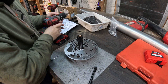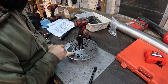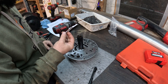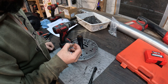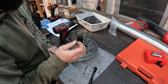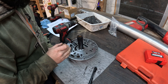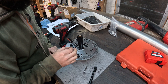This is the pump, and reading the instructions, this is your converter feed orifice. It says to drill it out to a 0.257-inch hole, three-eighths of an inch deep, so you can tap it out to a 5/16-18 thread to install this restrictor. It's just a brass set screw — you screw it in and drill the middle out to 125 thousandths. That restricts oil to the converter to optimize this dump valve setup. You don't have to do this, but it's recommended on LS engines and any engine with a weaker thrust bearing. It helps maximize your RPM gain with the dump.